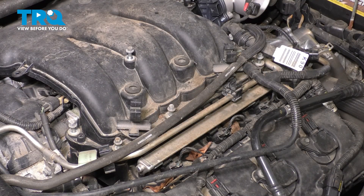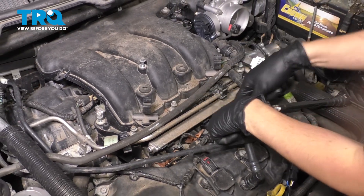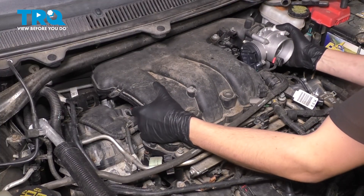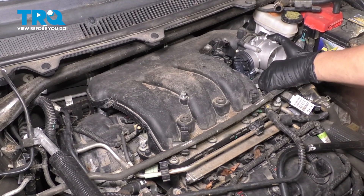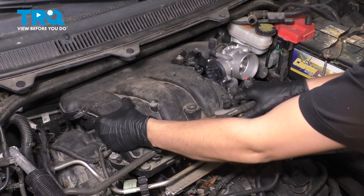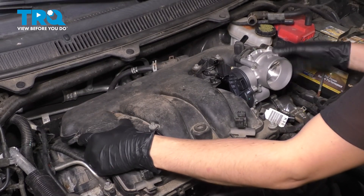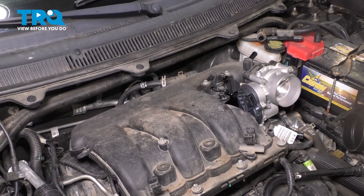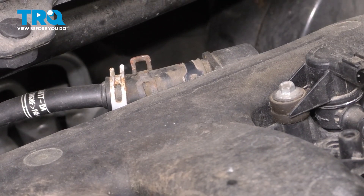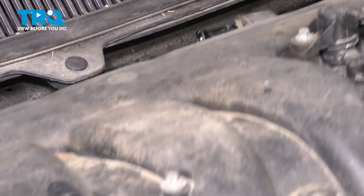At this point the intake should be unbolted and ready to pull up and out. If you have a lot of debris here, just blow it off or vacuum it. We can pull the intake up — you're going to have to get this wiring out of the way. Looks like it's clipped onto the intake, so pry the retainer out. Slide the intake back a little to clear these hoses, lines, and wires, then slide it up and forward. Don't go too far because we still have this hose at the back — just grab some pliers, pinch the hose clamp, squeeze it, slide it off, and move the hose off.